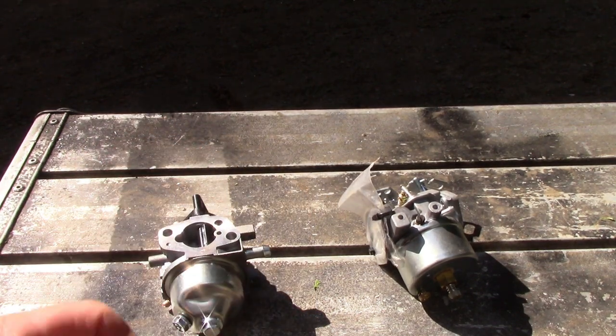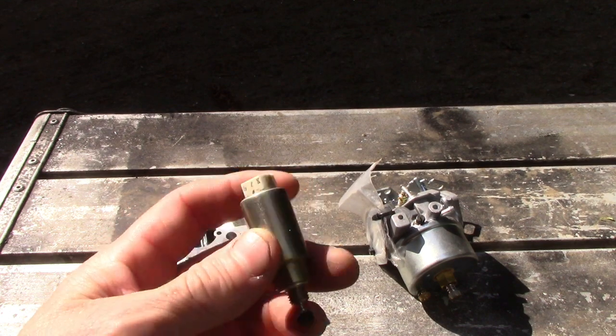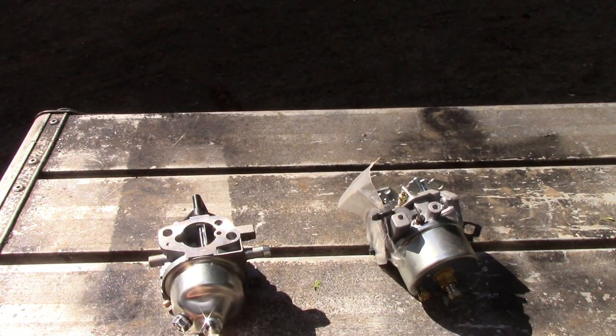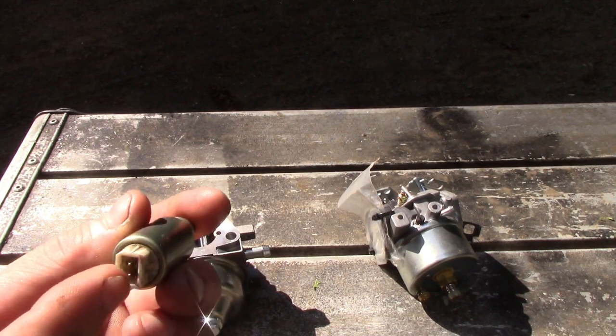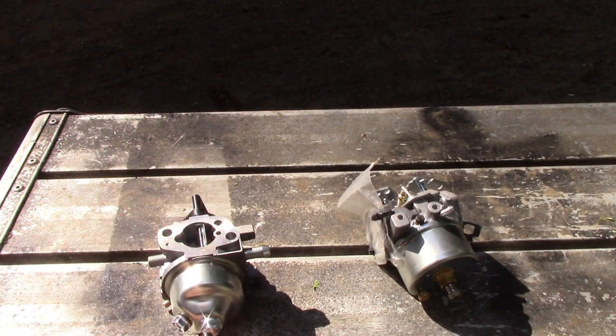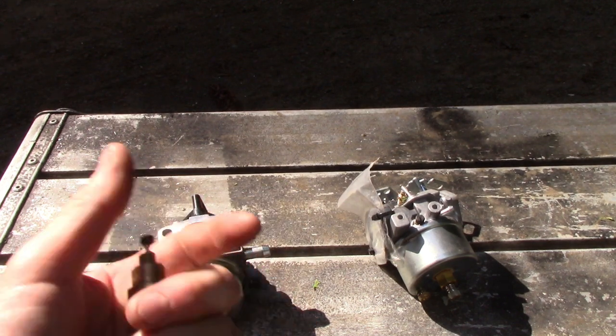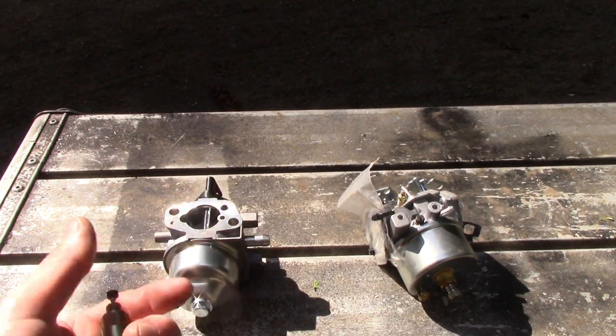If you have a double wire, then after you clip it off, you are going to have to send this back in there, because the 2-wire completes a circuit. So when you turn your mower on, the circuit needs to be complete. Single wire, you can leave the wire off or replace it with a bolt. So that's all I got.